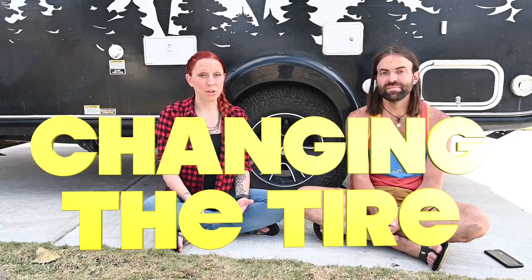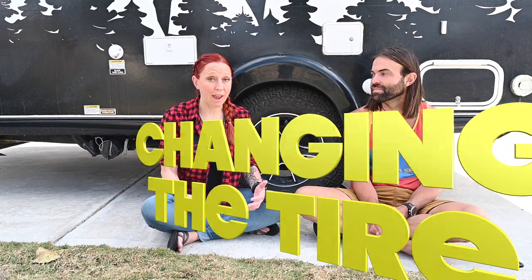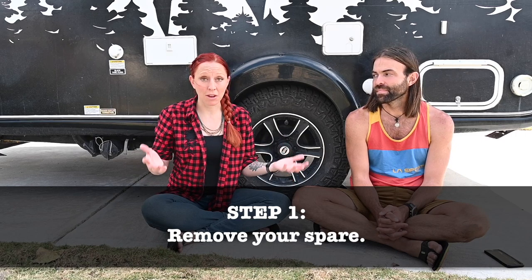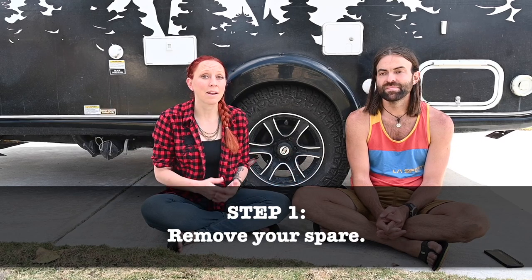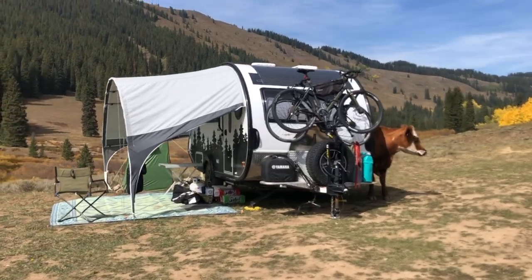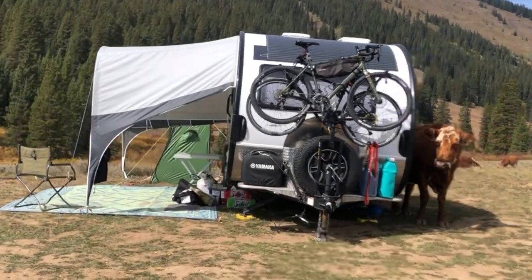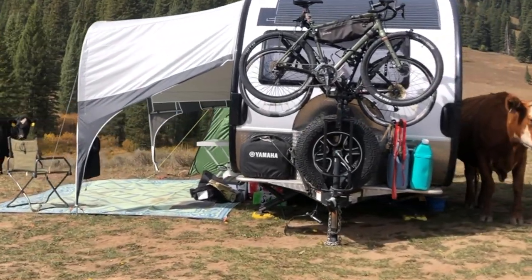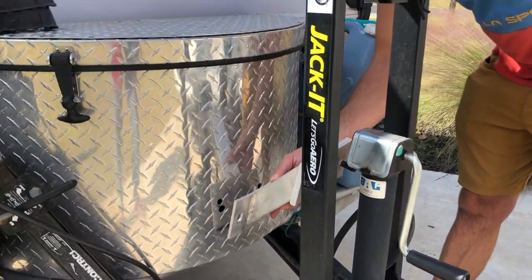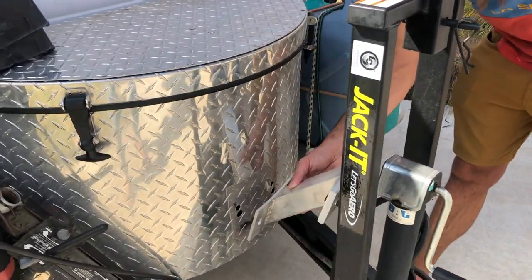So now we're ready to change our tire. Most of us have already learned from our dads growing up how to change a tire, but there are a few tips we learned while recently going through this. Step number one is obviously to get your spare off of the mount. Ours was up on the tongue, and one of our challenges was that we also had our bike rack next to our spare tire. Rather than taking the bolts off of where the tire was, we actually took the entire bracket off of the box that goes on the front of the tongue, and that really helped us out.